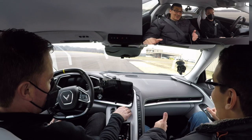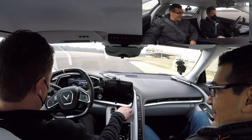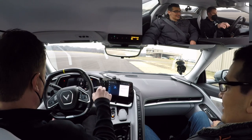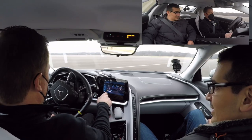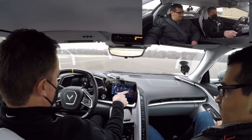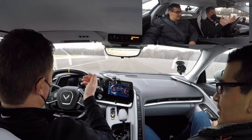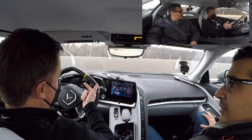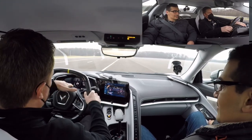So we're now going to be getting a ride-along with Bill Wise, the chassis control engineer on this vehicle. Let's try it out — toss it into stealth. Nice little quiet, silent drive off here. You have the unique center screen — you can see the power flow on this gauge. We can see we're using the front axle only. Orange means we're using propulsion. This is the engine — obviously it's off right now. If I go to the brake, you can see it'll switch to green, showing we see torque and we're seeing regen on the front axle.